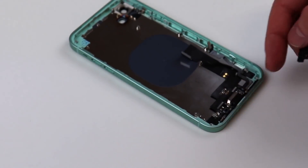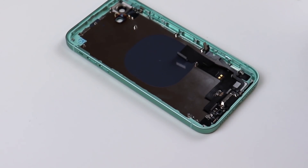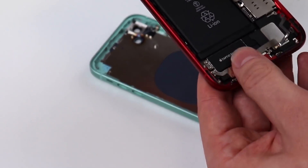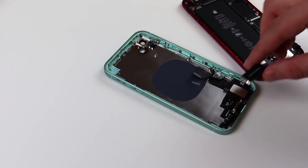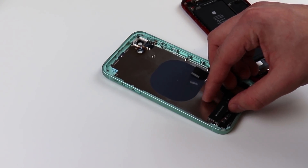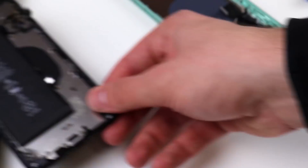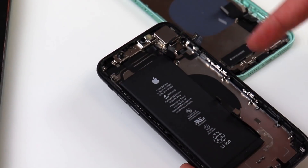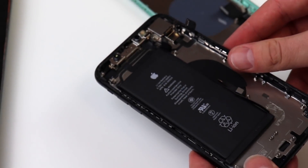We now have all the cables where they should be. It's time to start repopulating our iPhone XR custom housing, starting off with our loudspeaker. We're going to be stealing our taptic engine from our donor phone because our other taptic engine is pretty beat up. We'll move it over and reconnect it. Now that we have our charging port correctly installed on our custom housing, it's time to go back to our original housing and remove our battery as well as the front camera, the back camera, the flash, and the buttons — which I'm dreading to do. These are really difficult to transfer over, but we'll see how that turns out.